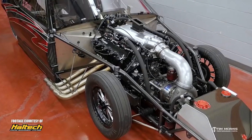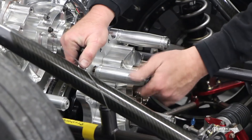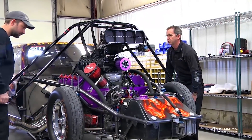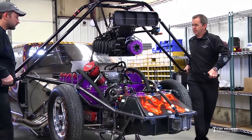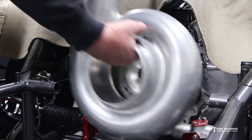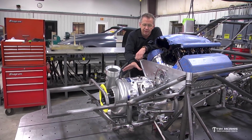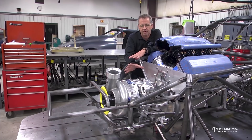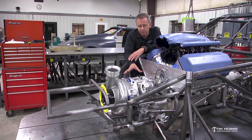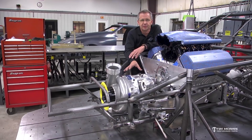But the end result is a really good combination. It's very, very durable and very easy to work on. I mean, if you've ever taken a roots supercharger off an engine, those things take two guys to lift — you need a blower lift tool and it still takes two guys to pick that thing up. But this thing you can pop off — one guy can pick it up easily. So again, this is a really good combination. If you haven't heard of it until recently, a lot of guys think, 'Where did this stuff come from?' Well, it has been around a long, long time, but now that the demand is high for it, it's getting a lot of revisions, updates, and changes. This is a big unit and they used to be considerably smaller, but this is going to be very prevalent next year.